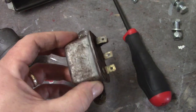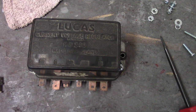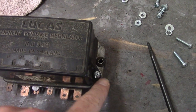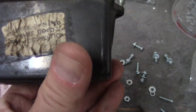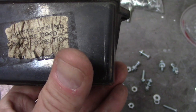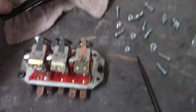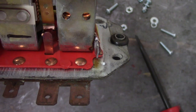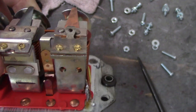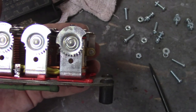This here is another stabilizer of some sort — I don't quite remember what that is, but it goes on the firewall. And obviously this is the starter solenoid here. I'm going to try to use all the original stuff. This here is the voltage regulator — the control box I had mentioned. This screw looks pretty new, so it's definitely been opened up and refurbished. There's a little sticker: 'Polarize Dynamo, Ensure Good Connection.' It looks all nice and shiny inside — brand new. Unfortunately there was some rattling in there — that portion is all melted away. A little spring arm came in contact with that bus bar and stayed there and ate itself. So unfortunately I won't be able to use this even though it looks brand new.